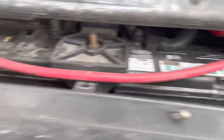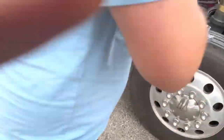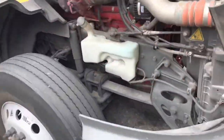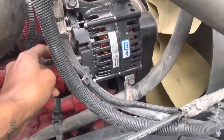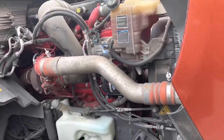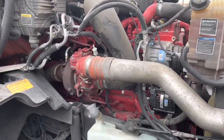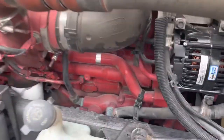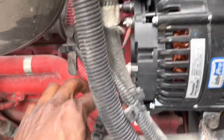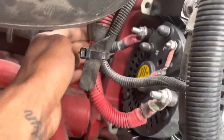So maybe this will help y'all out. I stopped, popped the hood, checked my batteries — it needs a little cleaning but I know that's not the problem. So I checked the batteries, it's a little corroded but looked fine. Then I went over and checked my connections on the alternator. This is a brand new alternator — I checked it, it's not wiggling.